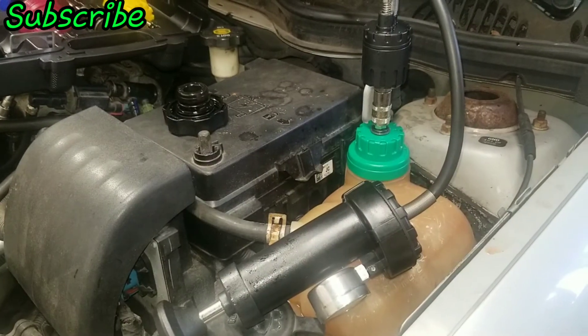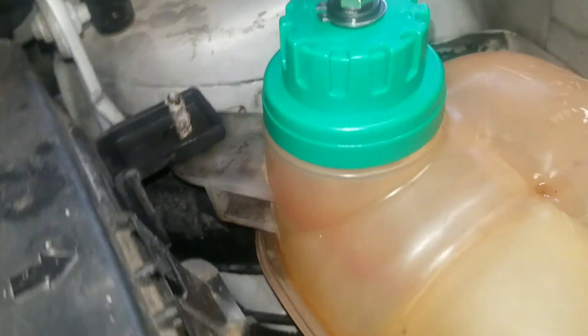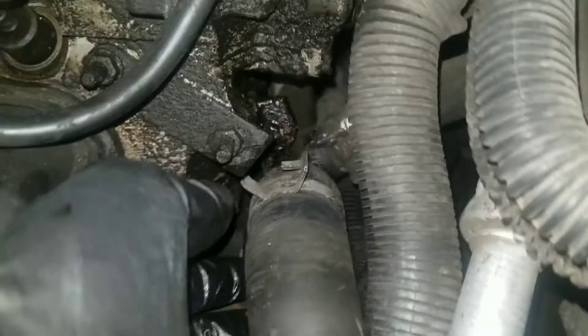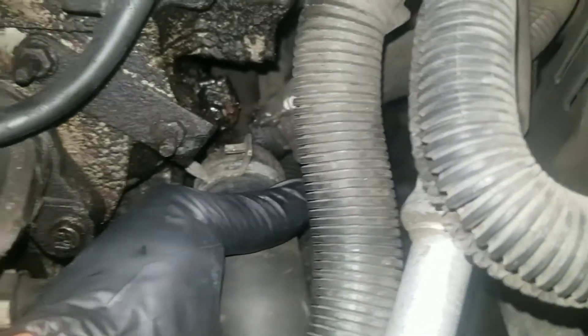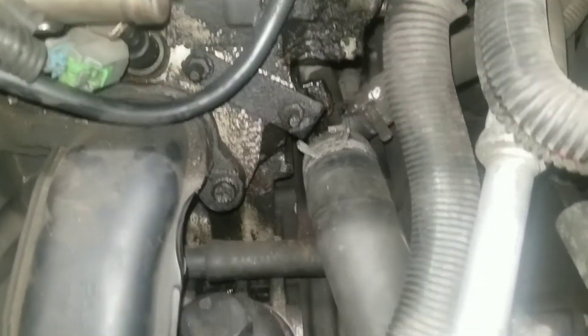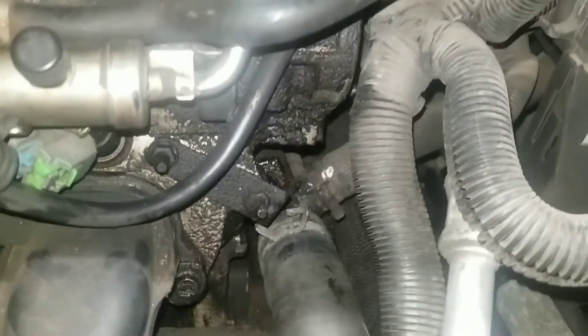While it's sitting I can go around the car and look for any visible leaks — check around the cap, check the hoses attached to it, check the radiator hoses and feel at the bottom. It looks like I have a little leak coming from the bottom here — let me wipe that off and double check.